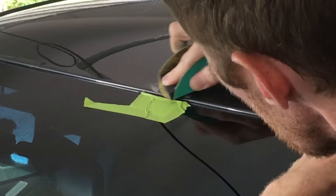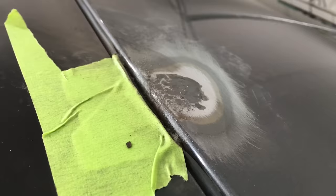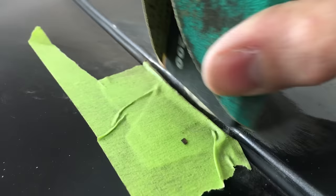I have a brass brush, which is probably too soft for this job — I'd go with a steel brush for something like this. Now for the vertical edge: the 80-grit paper is thick and rigid, so I let it hang down past the edge of the block to get into the crack. I'll just keep doing this until I'm past all the rust. Ok, I'm done sanding for now — 80-grit sandpaper really made this go fast.